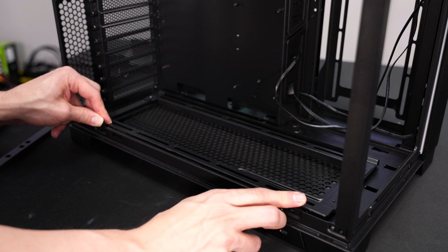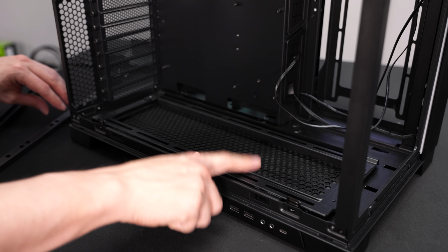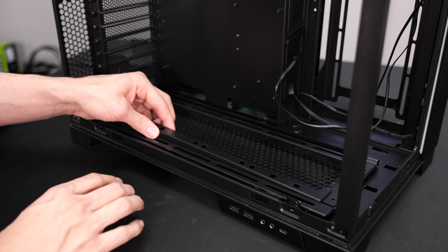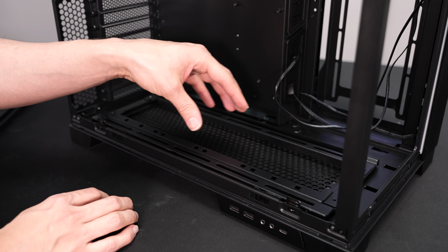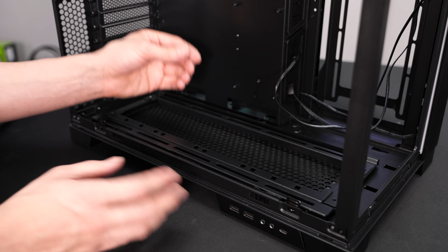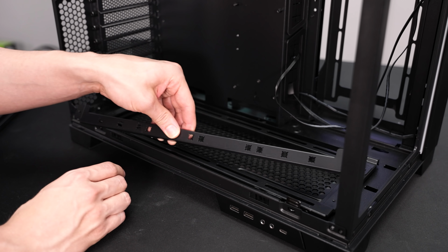Also, in addition, previously you had mounting possibilities for hard drives on the bottom. And now those additional holes were moved to additional metal bars. Because if you don't need to mount an HDD on the bottom, those bars would block additional airflow, which is bad for performance. So it makes absolute sense. If you don't need HDDs, you're just not using those bars.